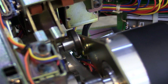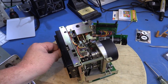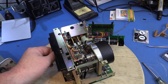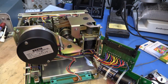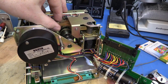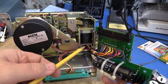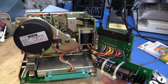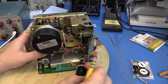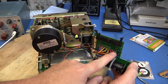Here's one of the magnetic encoders in the back of one of the hub drive motors — I'm just turning it by hand. It feels like there's an awful lot of friction in those two hub motors. I don't know if they need oil in the bearings or if there's some type of brake mechanism. With the connector board hinged out of the way, we can get a better look at these dual-coil solenoids which engage the mechanism and latch in place. Three wires come out of one of them, probably for two different coils to pop in both directions. There's a lot more tracing to do to make sense of this mess of wires from the various solenoids and motors into the back of the board.